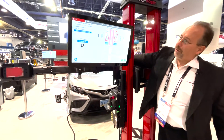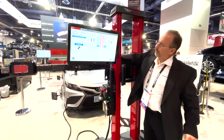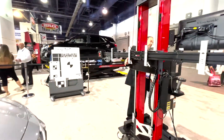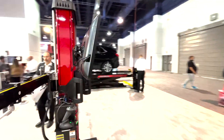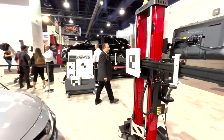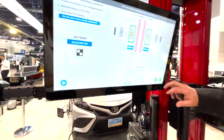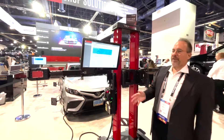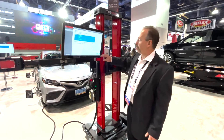So we get position hanger three here, and then position hanger number two. We will hang the target on the front of the frame, verify that the target is in the correct position, and hit next. We will at this point go to the vehicle and connect the scan tool, start the calibration procedure. Once the calibration for position one is completed, we would hit procedure complete.